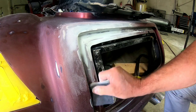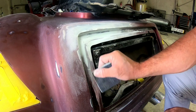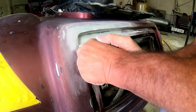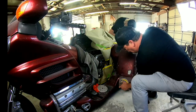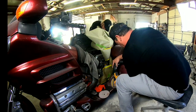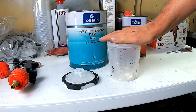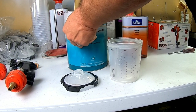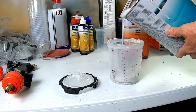I'm doing the final hand sanding in the jam of this luggage compartment. We're going to sand all those rough areas and smooth those out. One way to know that this R1 filler sands very easy — try hand sanding inside a tight area; it's very difficult, and this sanded very easy. Now Darius is hustling to get this taped up. I'm finishing up some sanding on some stone chips on the front of this tub, and then we're going to fill those with some spot putty.